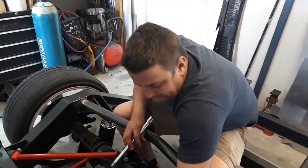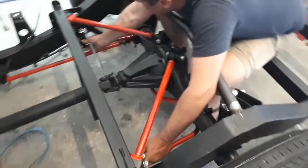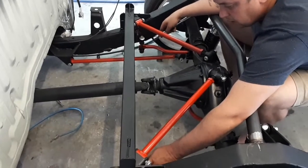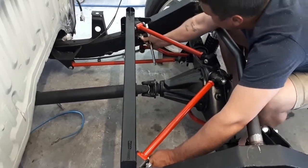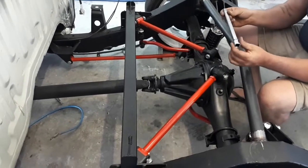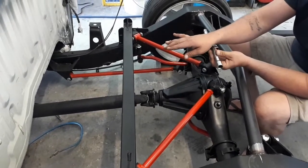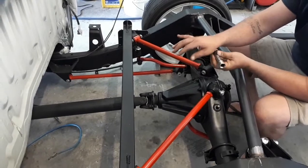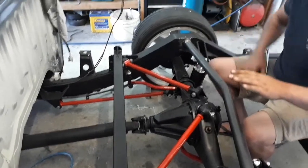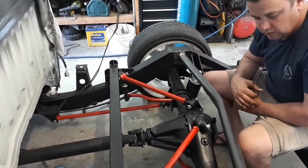So the bottom, this is my sway bar, and it will be mounted like so. I've just got to cut those tabs off, and it will be mounted like that. That's really going to help it rail once the car is running. As the car rolls around, so that's the vehicle and that's your live axle, it's going to struggle if I didn't put it in. It would be just a little bit woo woo woo, relying only on the suspension. Now with the sway bar, as one wheel comes up, the other one's going to push down. So it's really stable, a really good design.